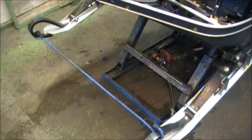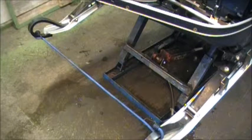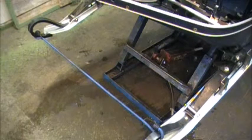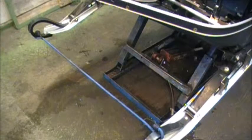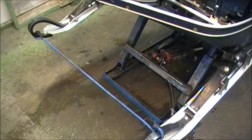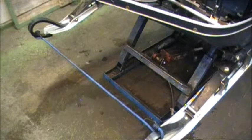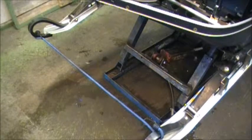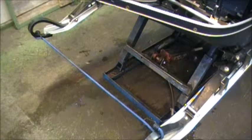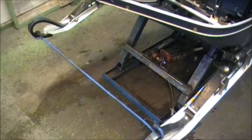Now, correct me if I'm wrong, but I've been told that you want very slight toe out on a snowmobile for straight line stability. Now, the steering on the W sled is pretty tight, mostly new components, etc. So what I've done here is I'm just taking any slack out of the steering with the bungee cord there,